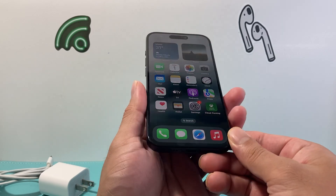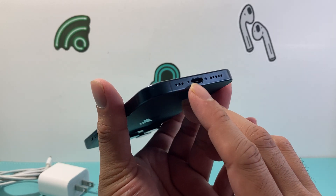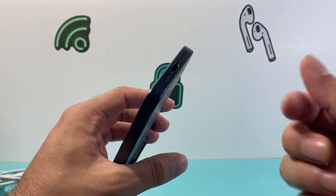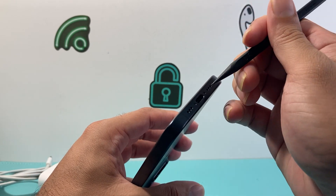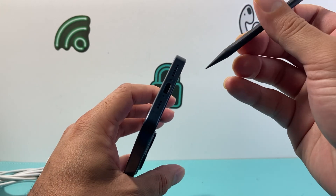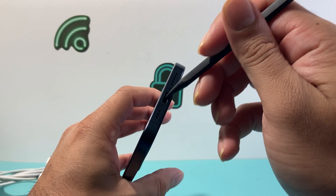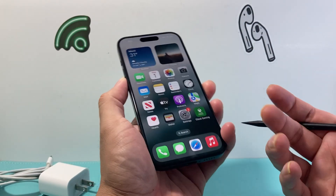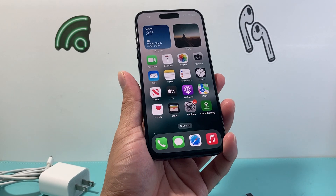When it comes to fixing your iPhone charging port, the first thing you want to verify is that there's no dust, debris, or lint blocking that charge port. It's really hard to see sometimes, so use a flashlight and take something non-metal to pick at it. You can also use a compressor — lint and dust blocking the port can prevent a good connection.